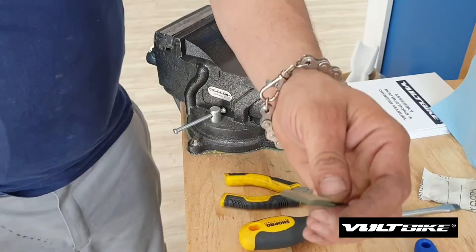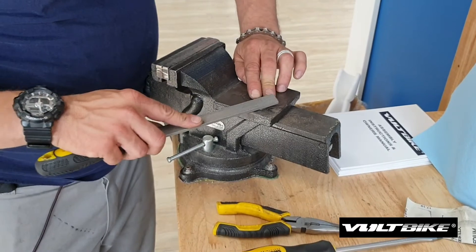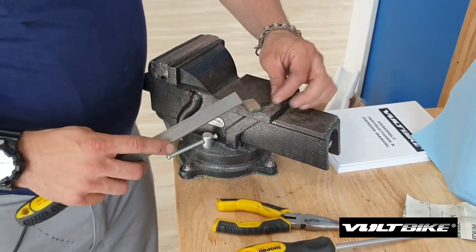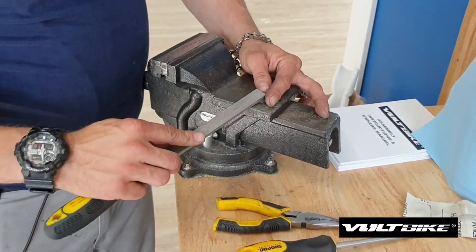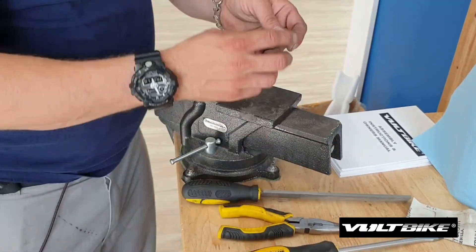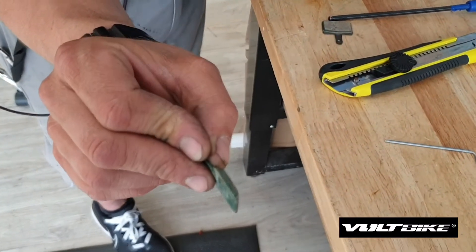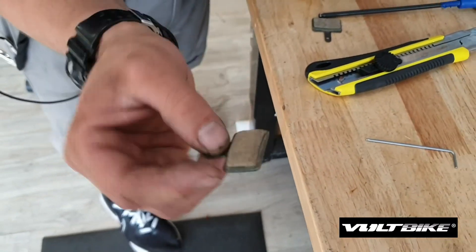Right there you see basically all you need. Some people go further and do the exterior edges here too. It's not a bad idea — it gives you a bit of a toe-in effect and a little more modulation in your braking. And there you have it — as you can see, there's a little bit of a chamfer on the bottom end of the leading edge, and that sort of stops the hooking and the noise.